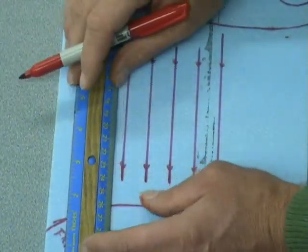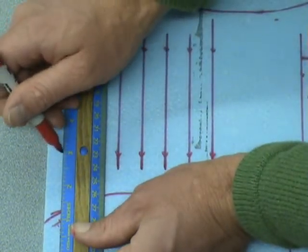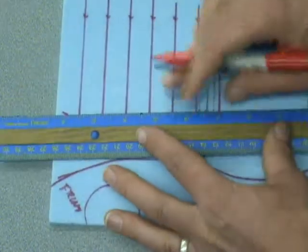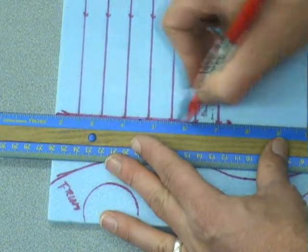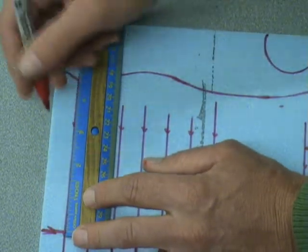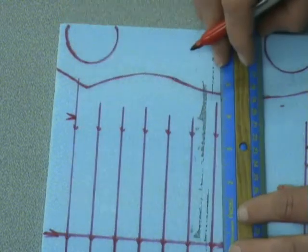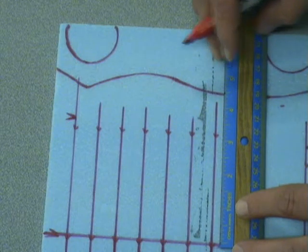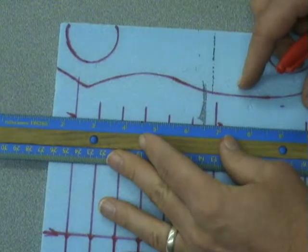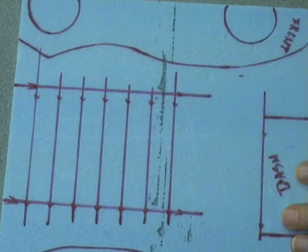Now I'm going to come over from the side and basically get my 0 point, which I'll make at 3 inches. And then I'll come down here and make a line at 3 inches, or arrow at 3 inches, and I'll connect those two arrows. And from there I'll make a line that comes from there 3.5 inches. So every one of these ribs is going to be 3.5 inches by 3/4. If you want to make a rib that is, or two that are unique, 1 inch by 3.5 inches or something like that, then I'll connect those. And now I'm ready to cut